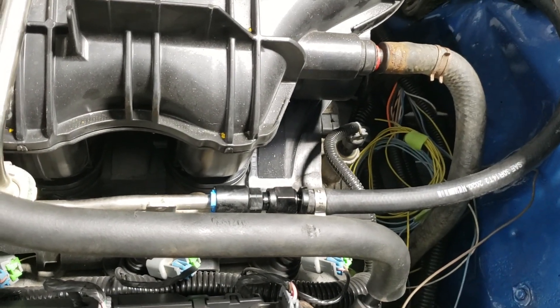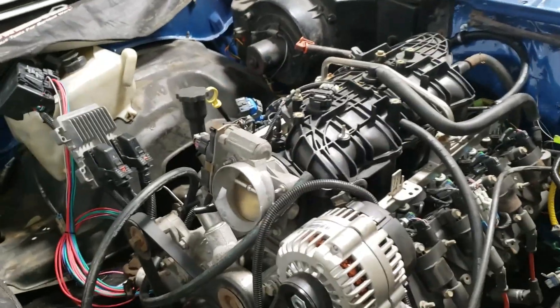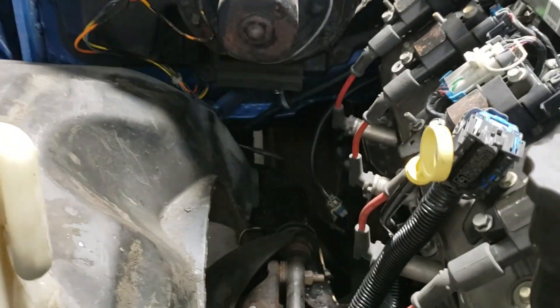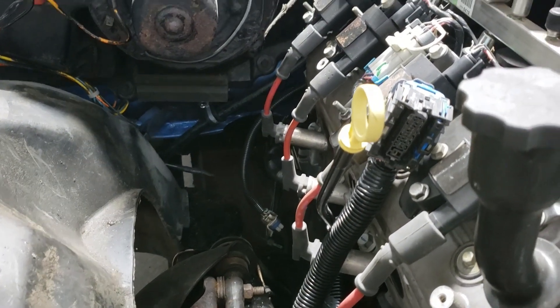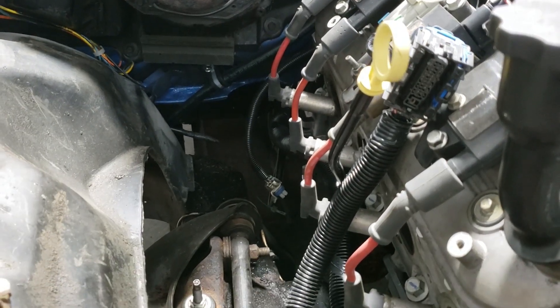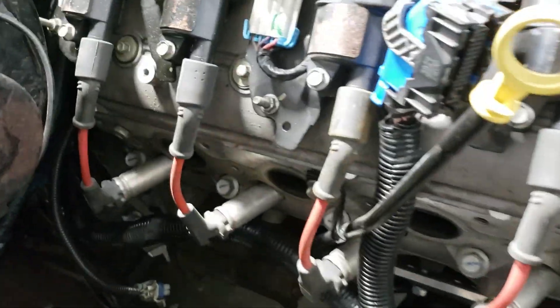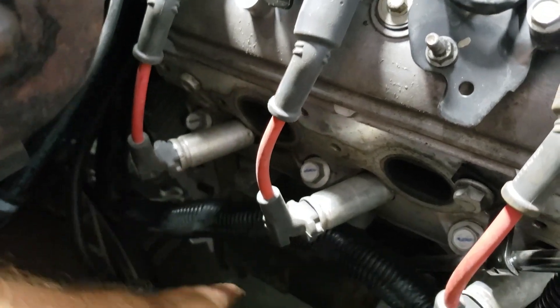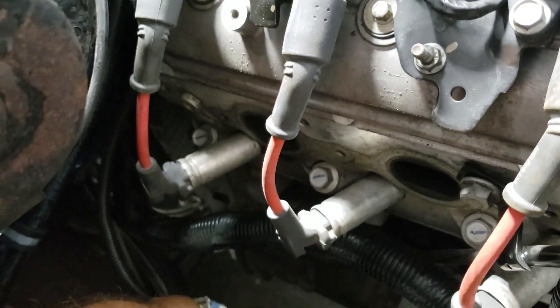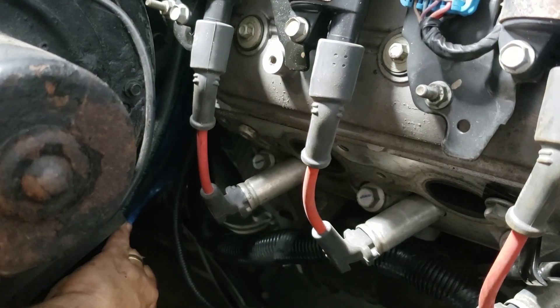So there's the connection to the fuel rail. You can see I've got it run around the firewall with those insulated clamps. I was careful to run it along the firewall where it looks like it'll be away from the headers. I don't have exhaust on this yet, but it is going to be pretty close — the headers go here and come down. I may have to relocate that after, so I need to be mindful of that before I call this final.